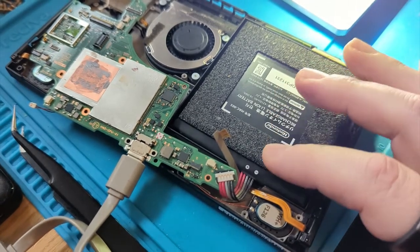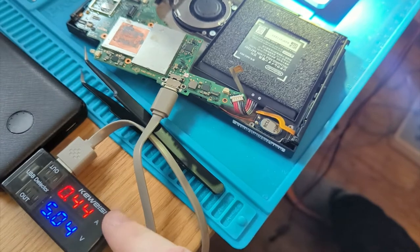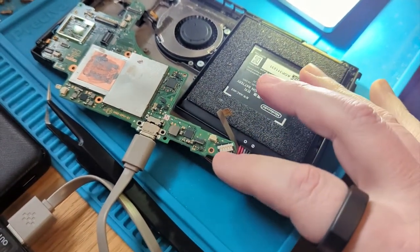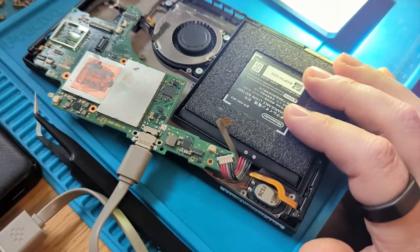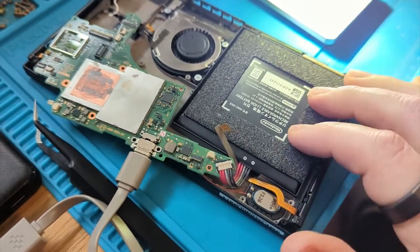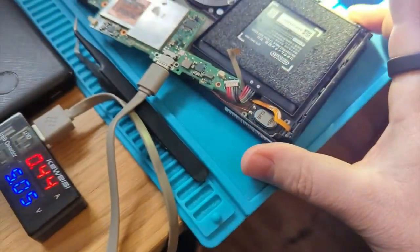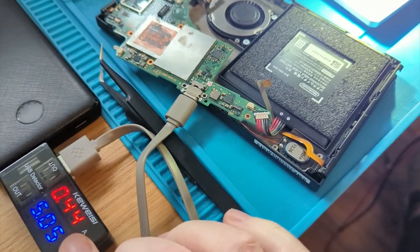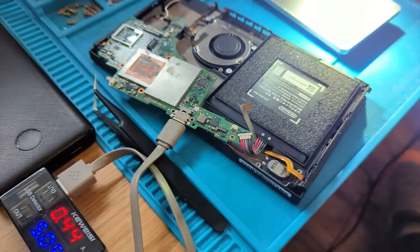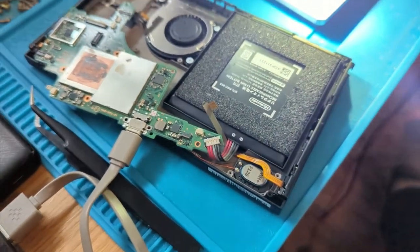The battery originally — I checked the voltage on this — it was 2-point-something volts. Actually the charge does seem to work; I've got it plugged into a charger and it's drawing 0.4 amps. Testing with a multimeter across the positive and negative legs of the battery, I can see it's up to 3.8V. But when it comes to booting, I hold down the power button and I'd see the amps drop to zero after 15 to 30 seconds. At that point I'd expect it to go up to about 1.5 amps, showing the board is booting and the screen is getting power. However, it drops straight back to 0.44, telling me the board is not booting.